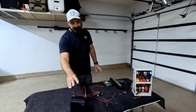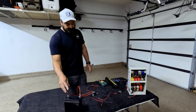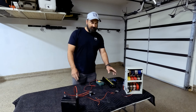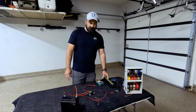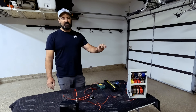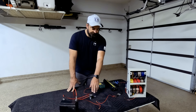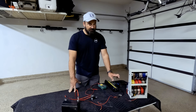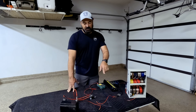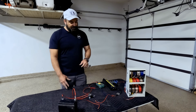What I have here is an ATV battery holding 12 volts, a couple of alligator clips that tie over to a relay, and a light bar that I'm about to install on my Rubicon. On the Rubicon, on the left-hand side, there's a little switch to turn the high beams on. I want to tie this relay to the high beam switch to power this light bar, so it'll power the relay and the light bar straight from the battery instead of through my lighting circuit.